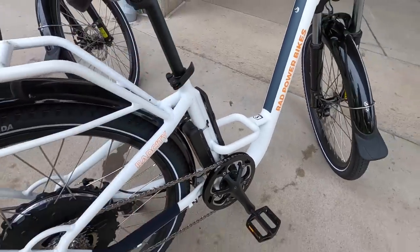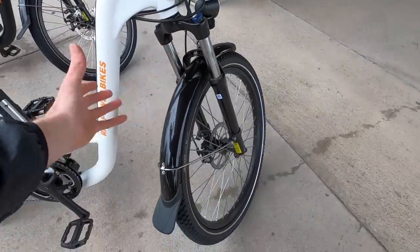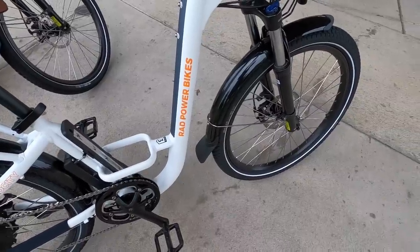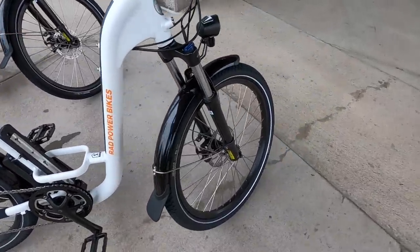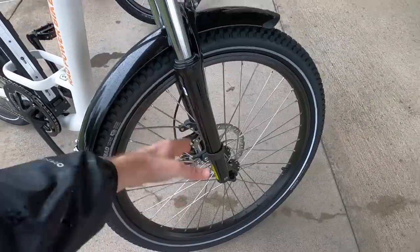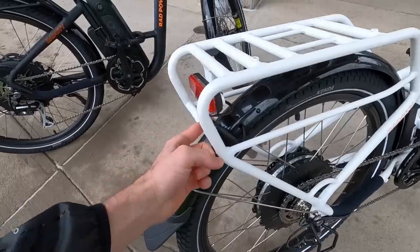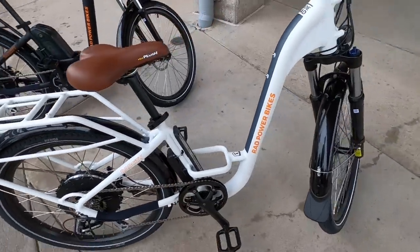So that's the motor controller. On the white model, things stand out a little bit more — it's a blend of white and black, the black fenders. These are plastic. They're offering good coverage. Not quite as low in the front as they could be. I've seen some really fancy fenders that go even lower, but these ones aren't going to get hung up on curbs, and if you're turning and pedaling and you bump that rubber flap, it's not going to get cracked. There's a little bit of rattle happening, but not a whole lot. I noticed these mounts occasionally slop around up and down — they aren't mounted directly to the lowers on the suspension fork. In the rear it's a little bit less. There's a mounting point right there, and back here we've got the light with a cable running underneath the fender and then down through here, so their wire management is pretty good.